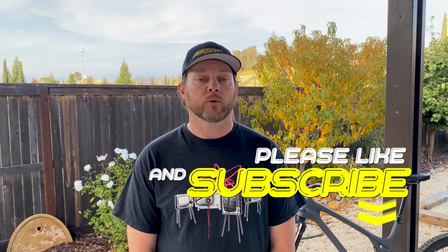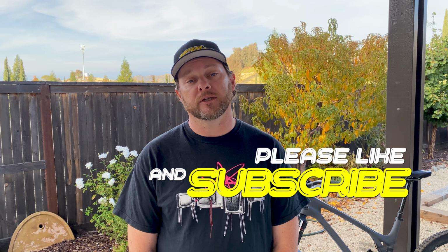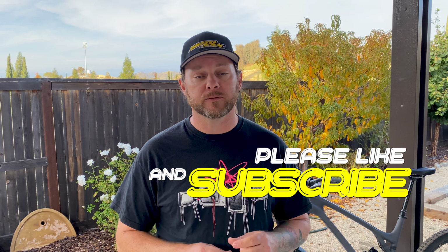Today I've got another video on the Evil Insurgent. This is the new V3 that just came out summer of 2021. What we're doing today is changing the geometry. And what that means is that I'm going to switch the flip chip in the rear suspension linkage from low to extra low. That's going to change our geometry at the head tube and the seat tube. And what I'm going to do next is ride it tomorrow at one of my favorite downhill trails, climb up the hill, ride down, and see if I can tell any difference.